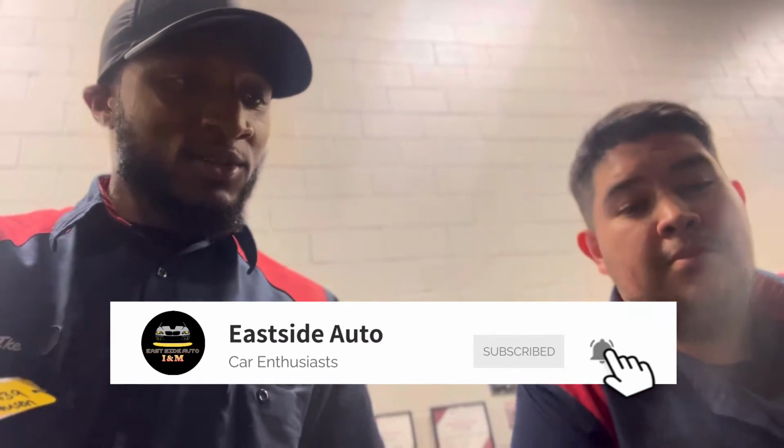We got a Kia Optima we're gonna go ahead and do a valve cover gasket on today. Just some basic maintenance. Customer came in last week complaining of a burning smell coming from their air vents when the air is on. We lifted up the hood and we found that the valve cover gasket was leaking down onto the block, and that would burn off, and in turn they would smell that when they're actually driving.